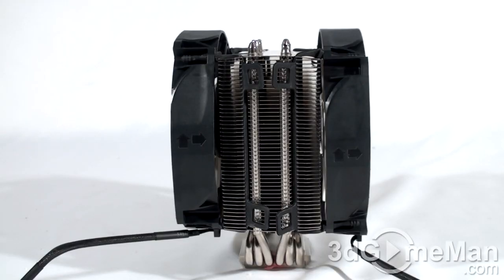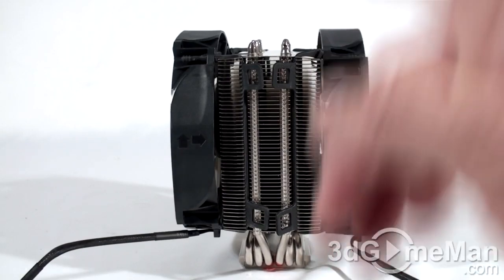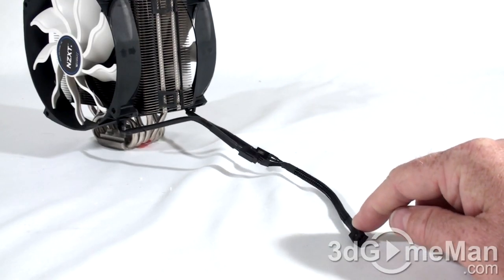Note the direction of airflow — both fans are pulling air in and pushing it out in one direction. You don't want one fan pushing air in and the other also pushing air in; you want a nice flow of air going through all of the aluminum fins. Also, position this on top of your CPU so that it ports warm air outside of the case — orient it so it exhausts toward the back case fan, which then ports all the warm air out of the case.